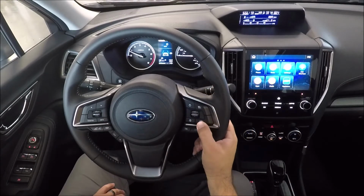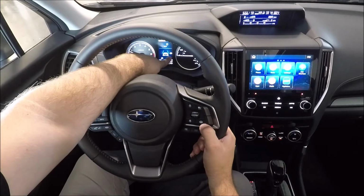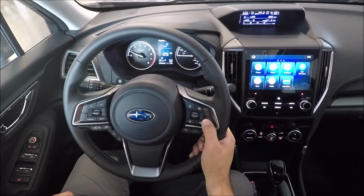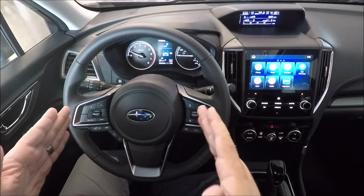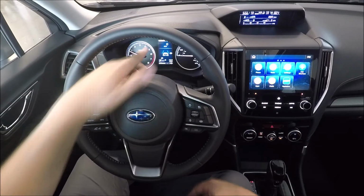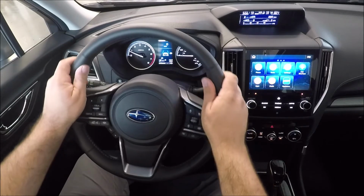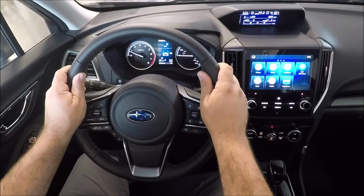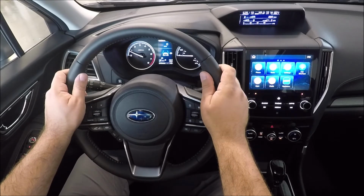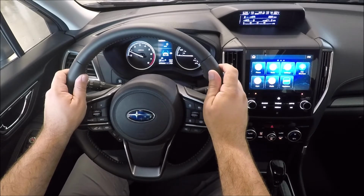You can also use adaptive steering, either with or without your cruise control. Adaptive steering has a picture of a steering wheel logo on the right-hand side of your screen. Again, that corresponds with the same button that you pressed on your steering wheel on the right-hand side. When active, it's looking for lane markings. You'll notice right now there aren't any lane markings other than the gray shadows there on either side. When those light up in white, it's telling you that it has enough visual information to be able to see the lanes, and it will subsequently change the steering angle to keep you in the lane. It's not quite a driverless car system yet, as the system does still require you to have your hands on the wheel. If it doesn't detect any feedback through the steering wheel, it will ask you to put your hands back on the steering wheel.